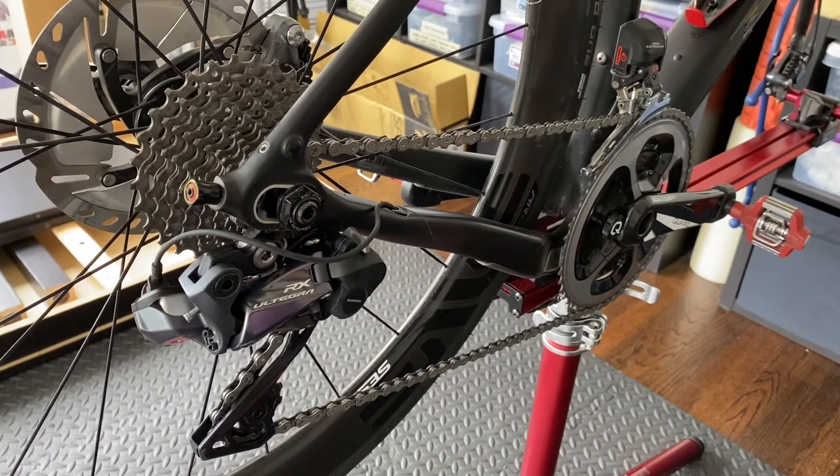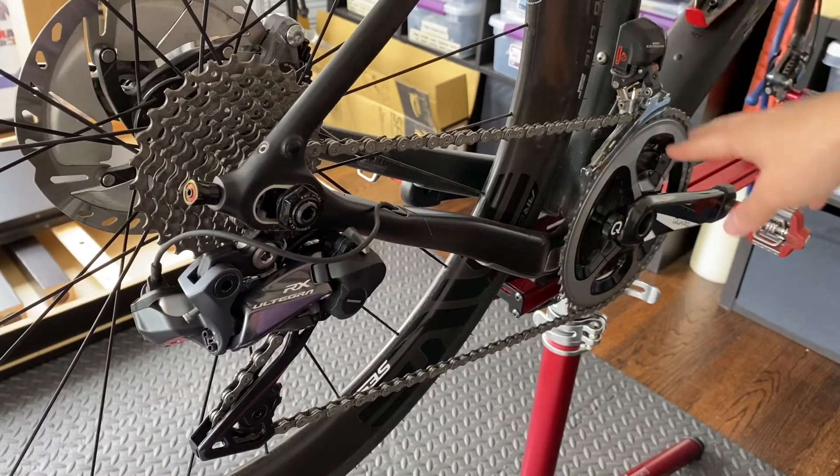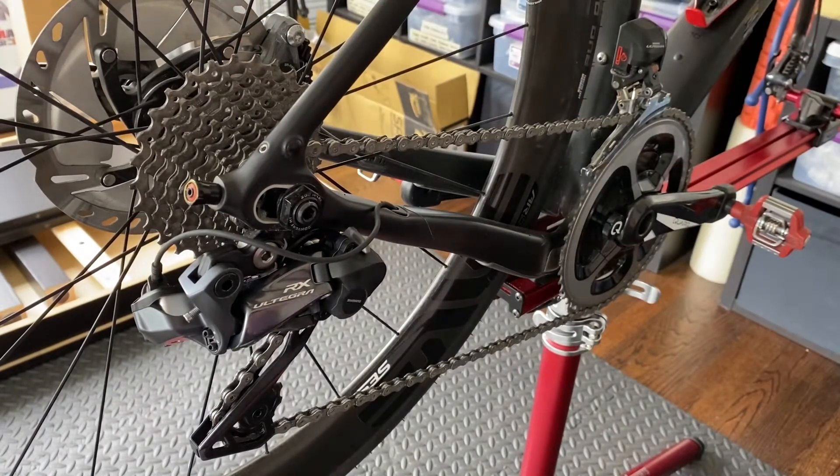Right now on the road it runs 11-28, which is the bottom end of the capacity for the RX derailleur. The top end is 11-34, which is good, but I anticipate that if I want to go into rougher gravel or bike packing I would need some lower gears — possibly an 11-42, 11-46, maybe even an 11-50. I'm also thinking about going 650b to get more tire volume for rougher terrain, which might require removing the front derailleur and running this as a 1x, so I'd definitely want more gear range in the back.